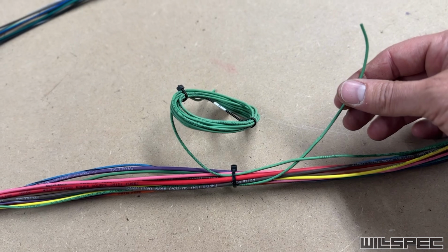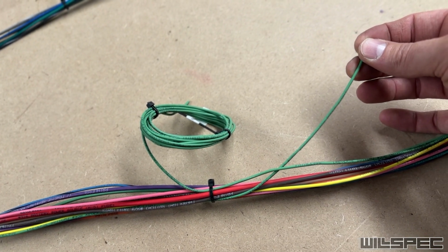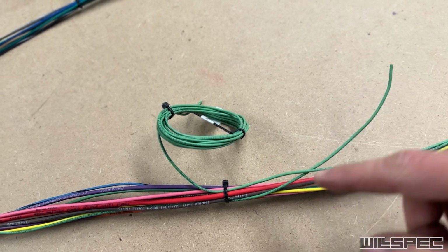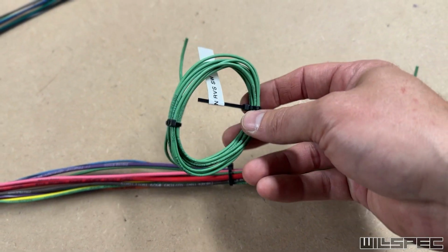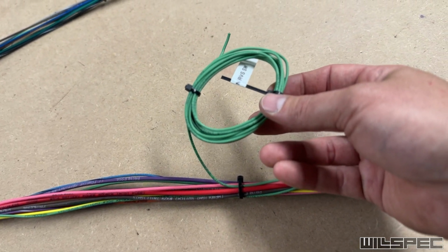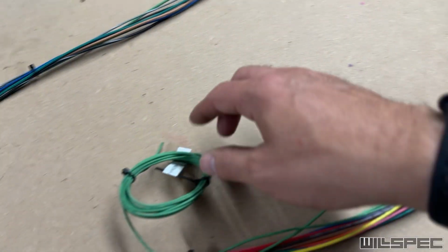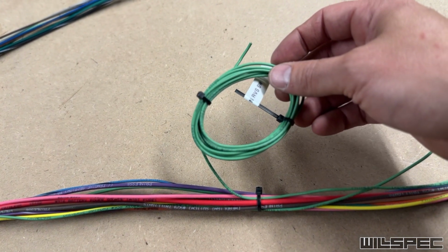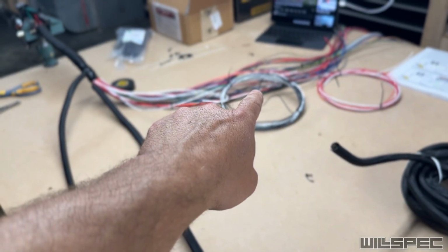This is the reverse switch circuit, so basically this gets power when the ignition's turned on. And I had this coming through the connector we got to put in this branch of the harness, and I also had this coming through for both reverse lights. Well, what I learned is that this actually has a splice in here somewhere that breaks it out into two wires. So only one was coming through, but actually what happens is you turn the ignition switch on there.